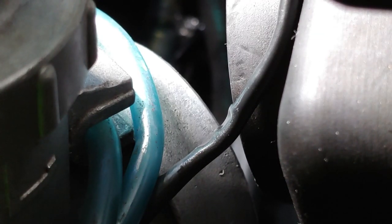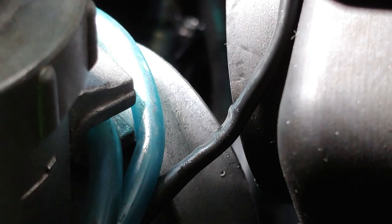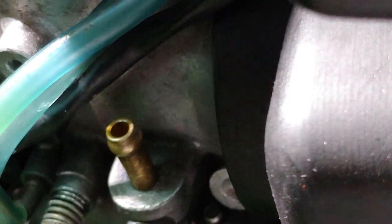I'm hoping it's just going to be pouring out or sucking this stuff in, because then I just replace the pump and I'm good. There were a couple times in the backyard where I pinned it and it just shut off completely. I don't think it's the stator because I had it rewound by someone who knows what they're doing, and they've got a lifetime warranty. That's why you don't have only one sled — you have multiple so the fun doesn't stop even if one goes out of commission.